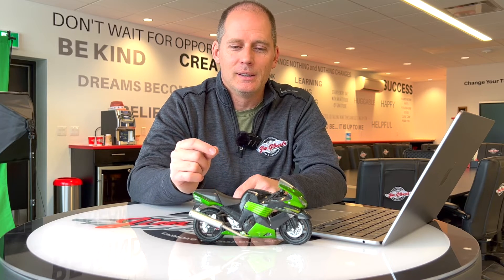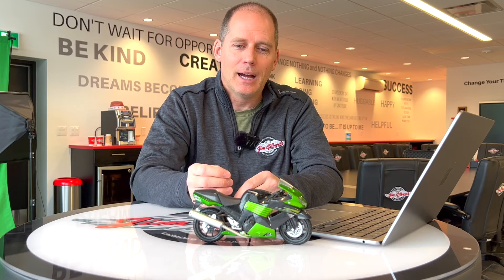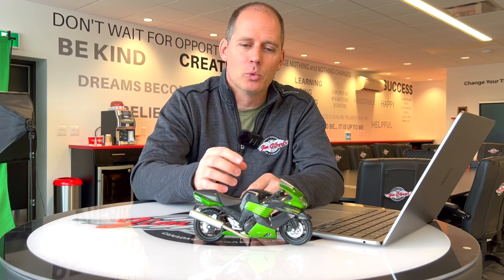It's not going to save you — it's not going to make it something that cannot be crashed. What it does do is allow the bike to sense when it has problems or inputs that you don't want. If your traction control is set to the highest level, it's going to say this person does not want these movements. If it's set to a lower level, it's going to say this person will be comfortable with some of those movements. So it allows you to customize the bike for your skill set, for the traction situations — slippery or rainy roads — and it allows you to change that on the fly to help keep you safer and make the bike more fun, which is how Kawasaki advertises it as well.